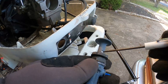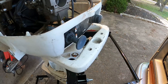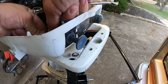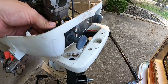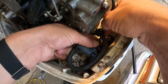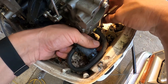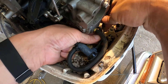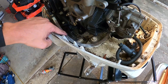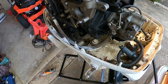New one on there, just reverse order. Tighten this up — that goes to the bowl. Hook up our main line that feeds the primer system. Then we're going to go back in and hook up our line that feeds the intake. Remember, these do not have chokes — these have primer systems. This white line here isn't factory but it looks very old. We are going to replace it, but we're going to try and start it first and see what happens.